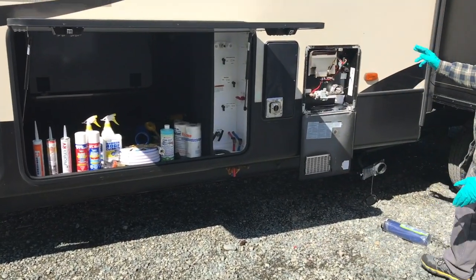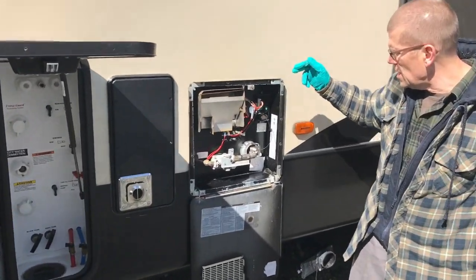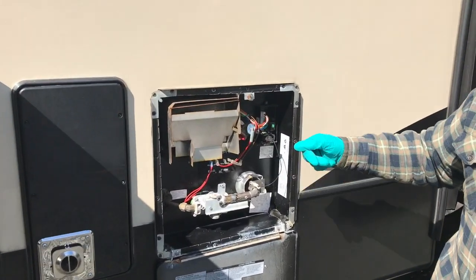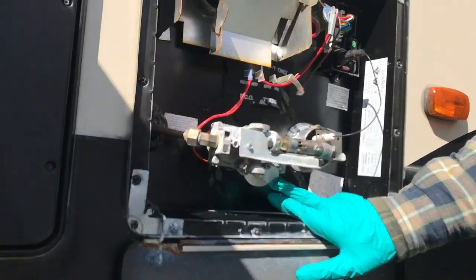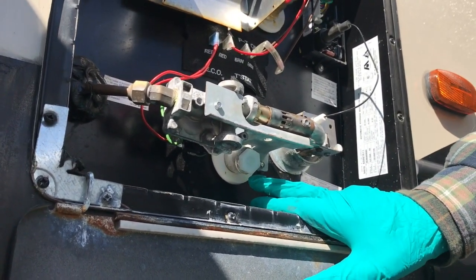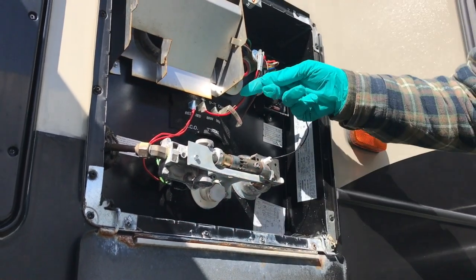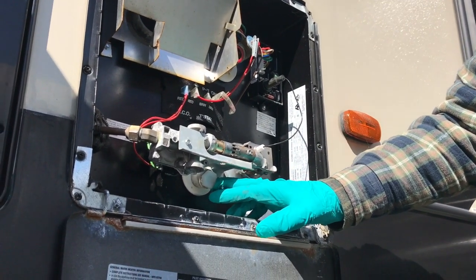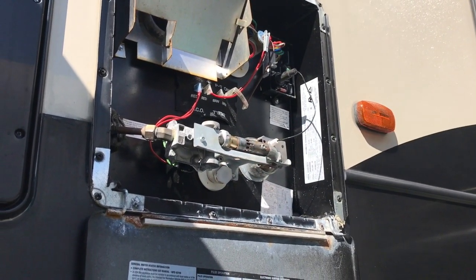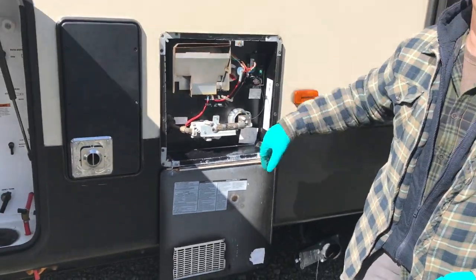From there, we have our hot water tank. Hot water tank is an Atwood hot water tank, so it means it has an aluminum tank. And down below here, you see a little plastic plug. This is where you would drain the tank if you ever needed to, or to winterize it. If you were going to do that, you would release the pressure first, then you would use a wrench, take that off, let all the water out of the tank drain. Something you might do if you went away down to Palm Springs in the wintertime, leaving your trailer up here where it's cold.